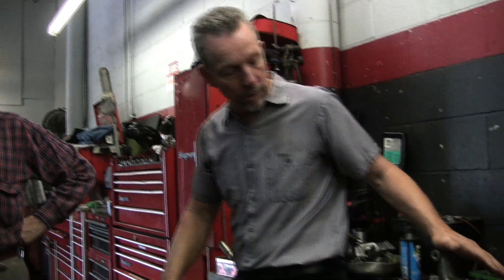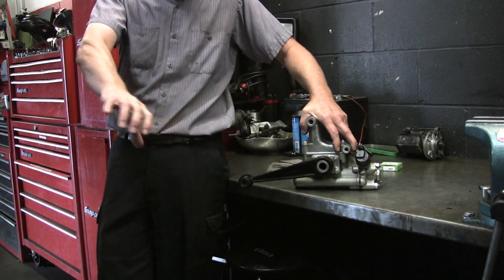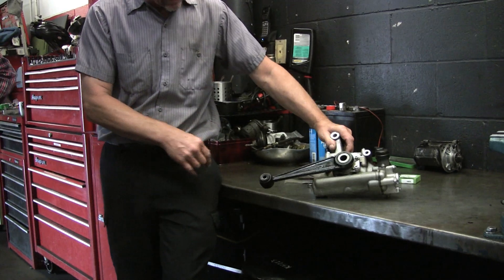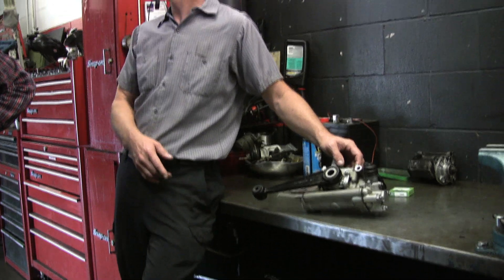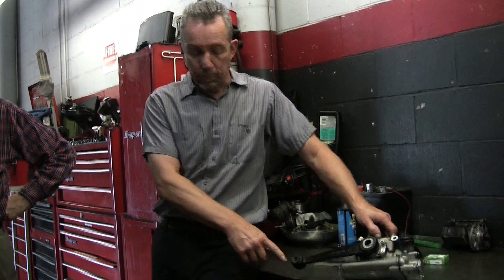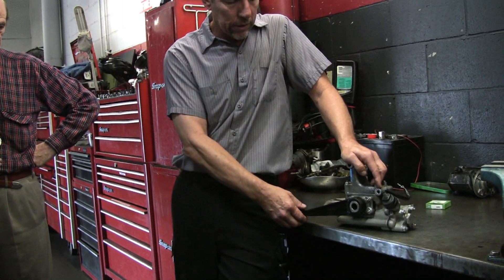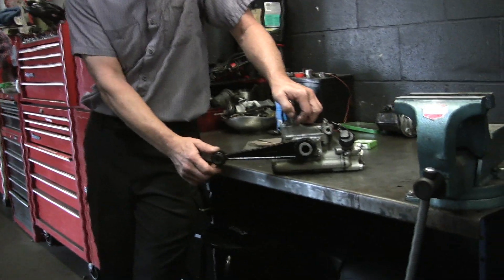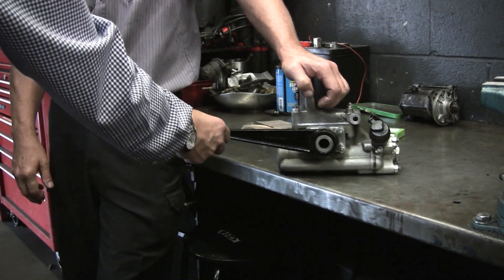I pull off the arms after I tighten up the spring and hold the suspension, because that's what keeps the wheel from coming off the bottom of the spring. But on the rear it's not so big a deal. There are two bolts that go through the frame, and this goes down to a link that attaches to the rear axle. One thing that likes to go bad on these is the bushings — I've seen a lot of cars where they're totally shot. This is just supposed to slow down the motion going up and down. If anybody wants to come up and move this, you can feel it has a nice action to it.